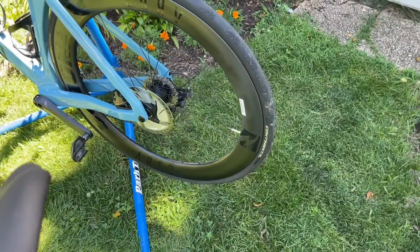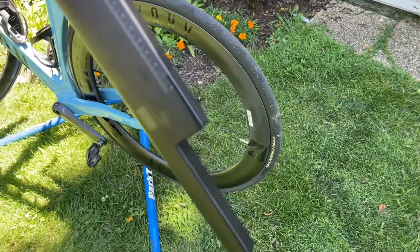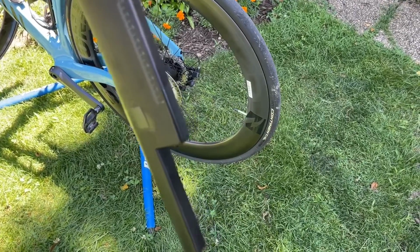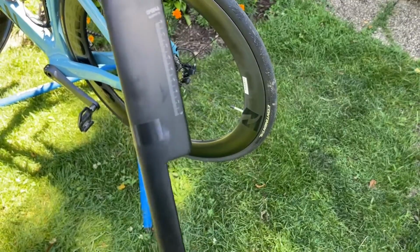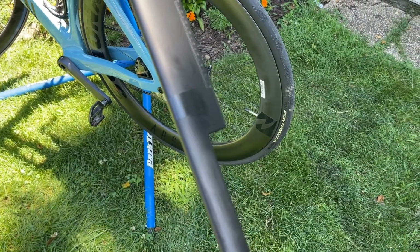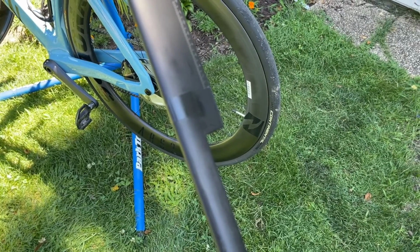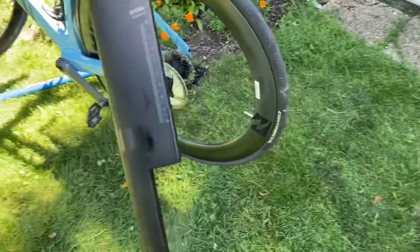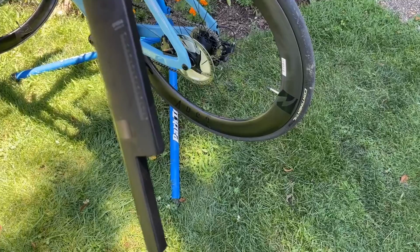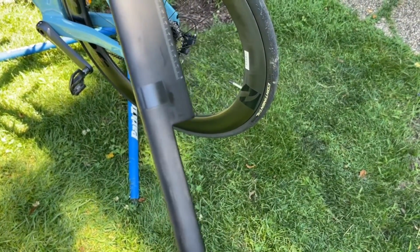And so in addition to all the greasing that I did, I also put a couple of pieces of tape on my seat post. I had read where other people had done that and had some good success. So I put a piece across the front where I think the seat post will come closest in contact with the hardness of the carbon frame, and also in the back, two very small pieces, but perhaps that'll make a better result.